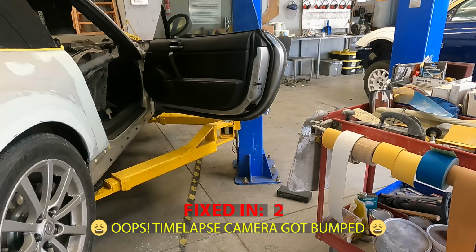This is the door clip. This gives it all of the wiring that goes through. So you can actually get a little prier. I used the clip popper tool behind it to pry it out. I did it from the other side, but you can do it without breaking the tabs. Even if you do break one, there's like four or five on this for that. So once you're here, the door can close, and then all you do is you wiggle it out.